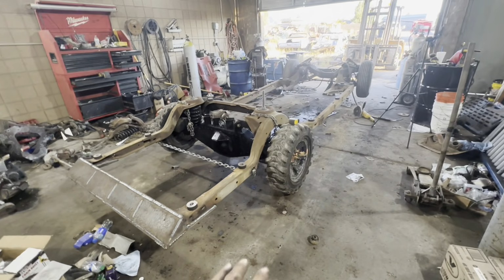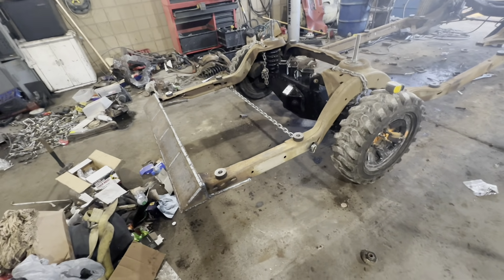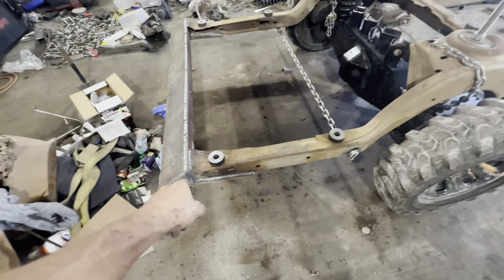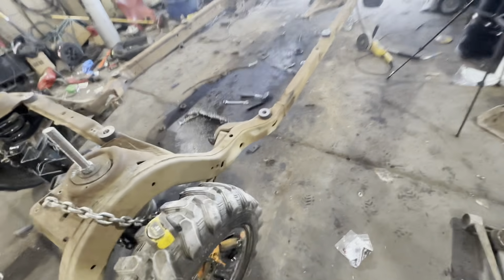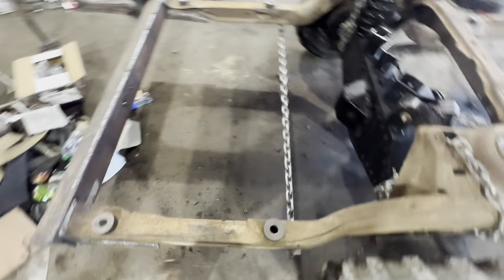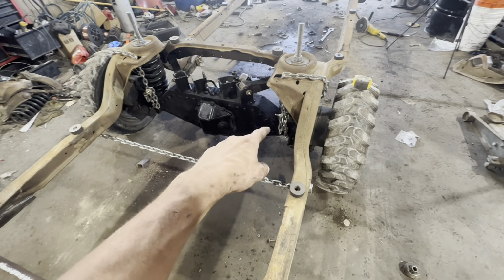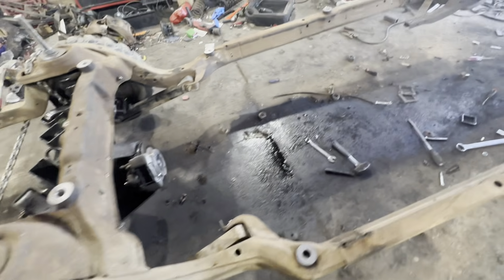All right guys, so we've got some progress made on this car. We got the rear bumper and rear bracket on, the 10 inches on the frame. Body pucks are just set there. We're just gonna go through and give each one a little tiny tack so it doesn't move on install. We got our side-to-side chain, our hump chain, our rear end all thread, and control arms are in with all grade 8 bolts.